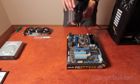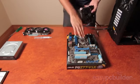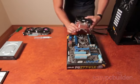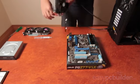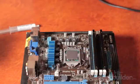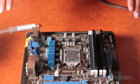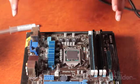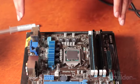So you may have noticed that there is no thermal paste on the CPU or the aftermarket cooler that we're using today. To ensure the correct operation of the computer, we'll need to install this. Most aftermarket coolers do not come with thermal paste supplied. You cannot miss this step. If you do, you have problems with overheating, crashing, and inconsistent temperatures on the chip, shortening its life.